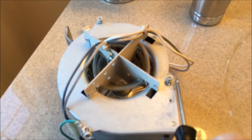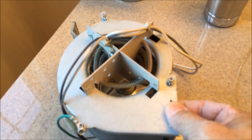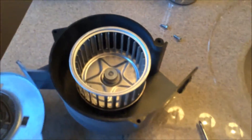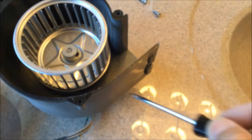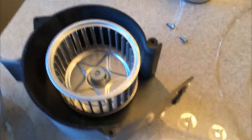What I've done is I've removed three screws — one, two, three. I'm going to lift this side of the housing off. With the housing off, I can remove the blower wheel. It's probably a set screw — yep, there it is. Remove that blower wheel set screw, pull the blower wheel off, and tighten the two nuts behind it.